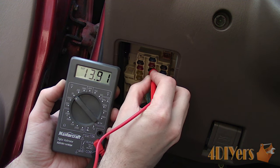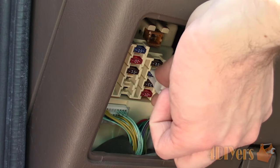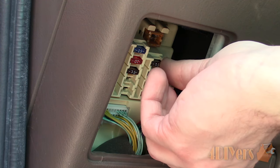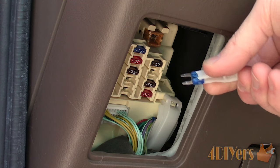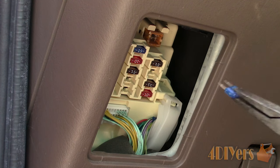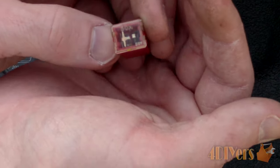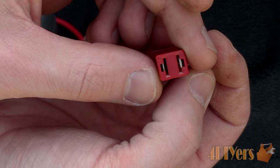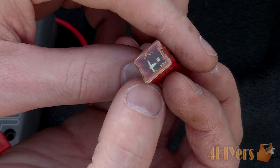A fuse can also be removed for testing and inspection. These are mini fuses, about half the size compared to the fuses used on older vehicles, and they tend to be a little harder to remove. Your vehicle may have a fuse removal tool found in the lid of the distribution box or somewhere within close proximity. Grab onto the fuse — they may need to be wiggled out when removing. If you don't have a removal tool or are having problems with it, use pliers instead. Don't get too aggressive as you can break the outer shell of the fuses — they're only plastic. With the fuses removed, you can see a close up. On the far right, this has a higher amperage — as they reach a certain rating they'll become larger. This is rated at 50 amps; these can be inspected through a clear window on the top. They're removed in a similar way to the smaller spade fuses, but they do not have test terminals on top.